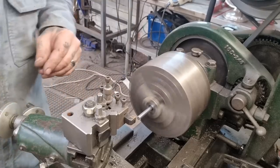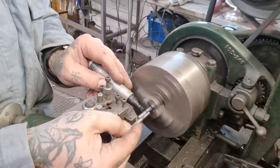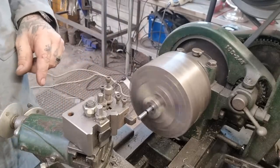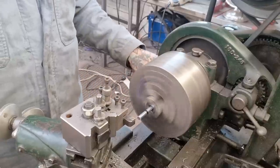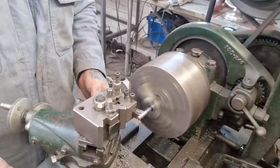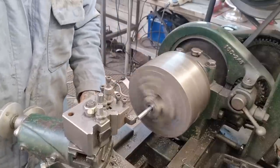What I need to do is mark off the length of the existing thread so we can echo it. We're going to cut the thread down to the end of that black mark. Now this is oversize by a good few thou, so I'll take a cleanup pass and then we'll measure the size. You can see it cutting as it comes back out due to deflection — it's old and not the heaviest machine, it's a little thing.